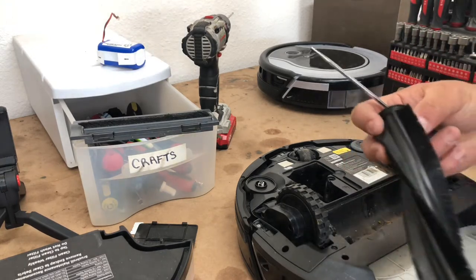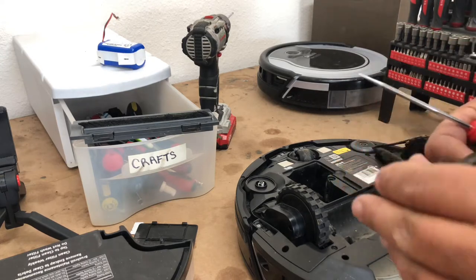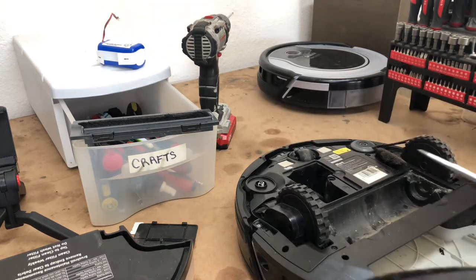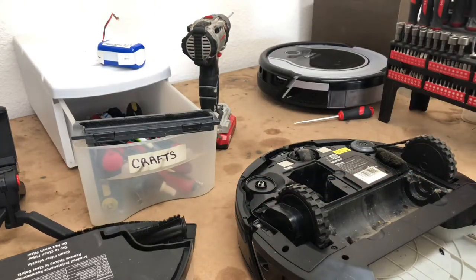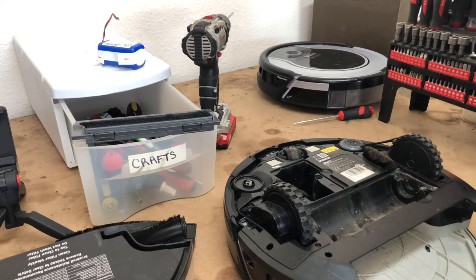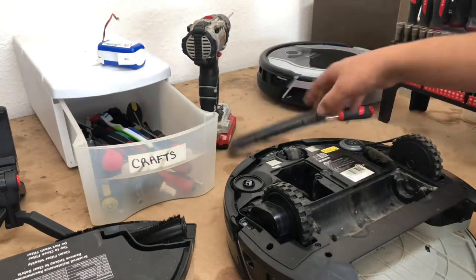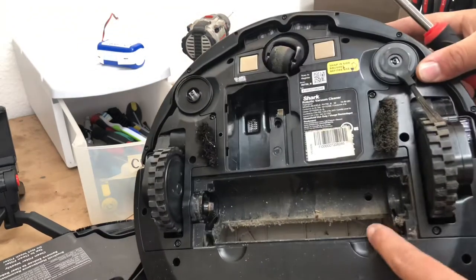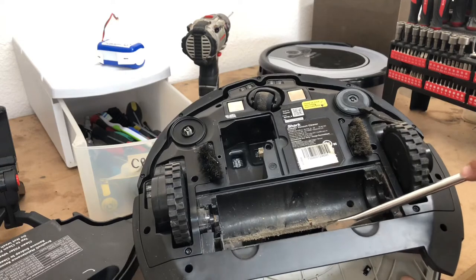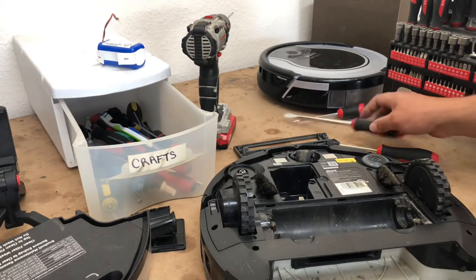One thing I will tell you right off the rip: if you have animals and it runs over piss, you might as well throw it in the trash, because that urine will corrode every circuit on it from the ammonia. Nothing we can do about that — most of the time they're complete trash. Now that you've done that, make sure you got all the hair off. We're going to replace that little cap. And no, I do not stock robot parts as much anymore — I'm trying to get out of it, but y'all are keeping me in it. Let's go ahead and do some scraping right here where the dustbin and everything connect, to clean that up, because that's where dirt likes to hide and then you can't get your bin to stay in.